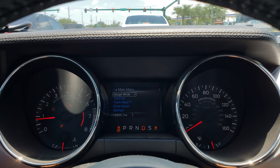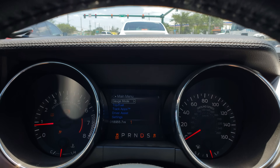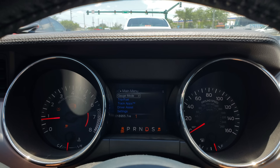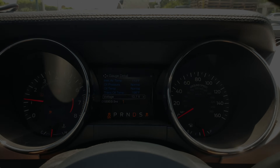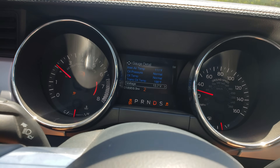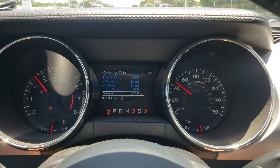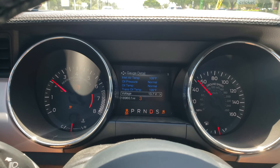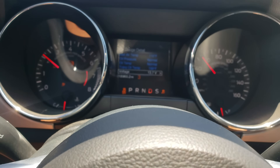This car still has the 3.15 gears and the 3C converter — all working just like it should. Now there's another thing to show for extremely high horsepower 6R80 guys — talking 750 and up rear wheel horsepower — especially if you're having trouble hooking in first gear. If you're a Mustang owner wondering why you'd want fewer gears over the 10R80's speed — when you're making a lot of horsepower, less gears is more desirable.